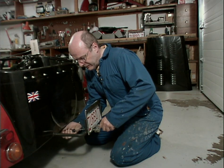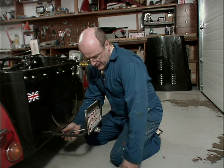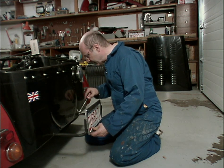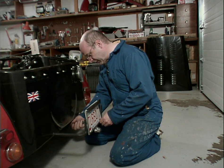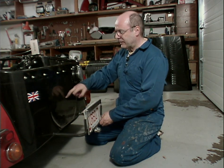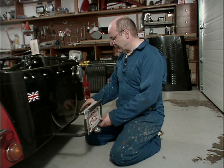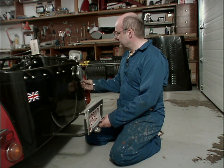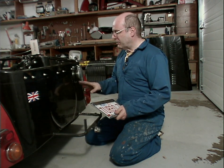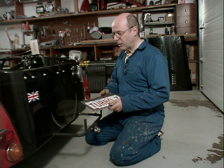This bracket is actually part of the frame, and on one trip I had several years ago, the frame broke right there. Well, actually there's the weld right there. It broke off on the right hand side, and it has to be welded back up. Because the gas tank sits right behind this tray, it's kind of a risky process to weld a piece of metal that close to the gas tank. There's the gas tank right there. The person who did it did a very good job, and he said to make sure the gas tank was full, because the vapor is more dangerous than actual raw gasoline.